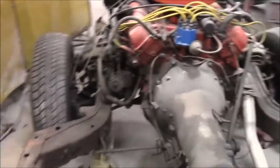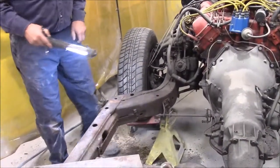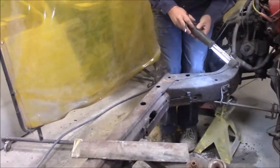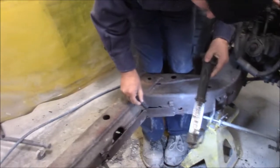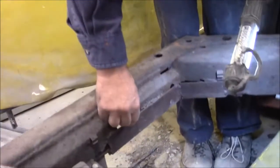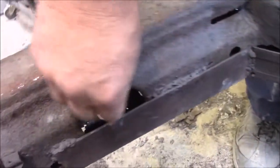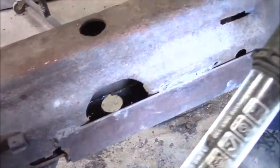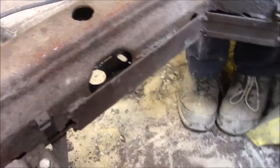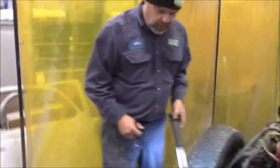Basically, the camera is now kind of in where the back seat would be on the driver's side of the car. So this is still the driver's side, and you can see how they've done the repair here, except the rot out is worse. You can see how rotten it is, and then through the bottom, I believe the camera can pick it up, there is a drain hole from the factory, but the rest of the holes, literally you could put your hand through the frame in 4 sections along here. So that's why we have to go as far back as we're going.